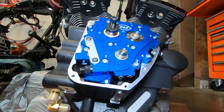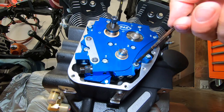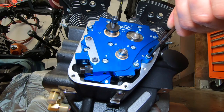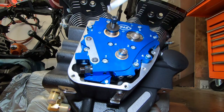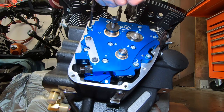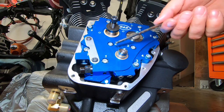In the description on this video, you're going to see a manual. You can download it. You can go to S&S. You can call them. You can get instructions on how to do this. This is how I do it though, okay? I tightened each bolt by hand, backed it off a half turn. Every single one by hand, tighten it, back it off a half turn. The pump bolt, same, back it off a half turn. So each one of these bolts, I went all the way down, then I backed it off a half turn, okay? So at this point, I'm going to rotate the engine. You're going to see this spin.